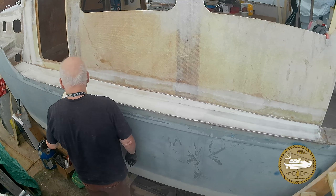See, the consistency of it is kind of like peanut butter — it will drip, but it will take a while. So I'm going to get my spreader and we'll get some of this on. The Quick Fair spreads just like butter and it is so nice to work with. You can see the color that it sets when it cures, and you don't really need to use a contrasting agent like the 3M Dry Guide Coat to see any of the low spots.